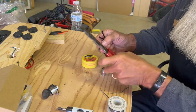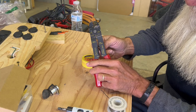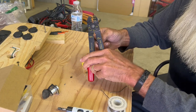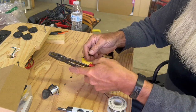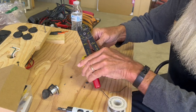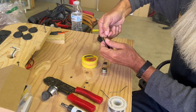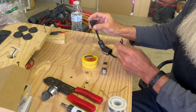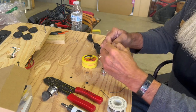So I thought I would show you soldering this plug together, getting this plug on here. What you want to do is just trim a little bit of that wire off for your plug. Probably just a smidge more than that. And then the same thing here. Those look pretty good, so then twist them up. And I said the positive is on the right-hand side or left-hand side as you're looking at it. So this wire here is the positive.